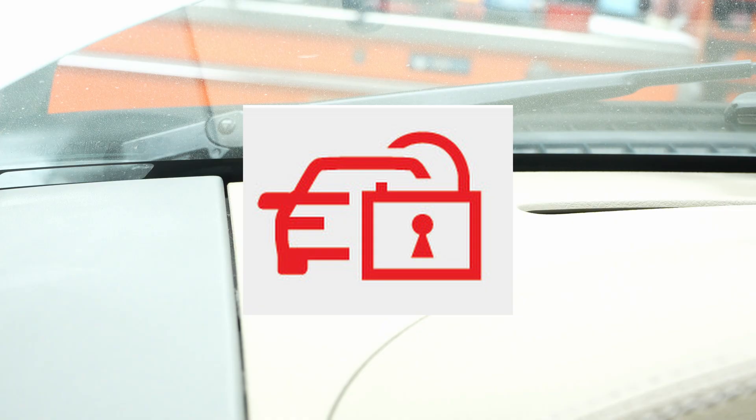Right here on our dash is our security light indicator. Basically this is flashing to tell us that the security system has been tripped, and no matter how many times we try the key — even if it's the correct key and everything's fine — it's not going to start because the computer is protecting itself because it thinks it's getting stolen. A lot of the time this light will be on the dash itself as a little lock symbol. Here's a picture of what that looks like. But on this particular truck, Ford put it there — not sure why — but you'll know when you see it; it'll be a big flashing light or a big flashing lock.